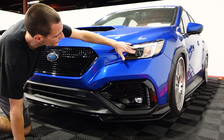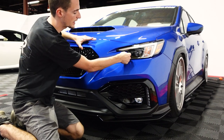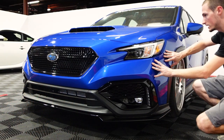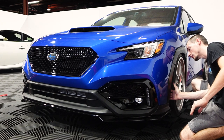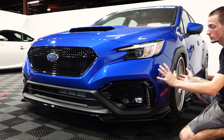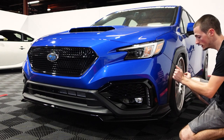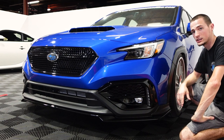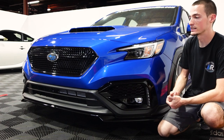When you come over to reinstall the side pieces, you're just going to come along the side and slowly push in. You'll hear that audible click underneath the headlight, then work your way around to the side. If it isn't clipping in, it could be stuck behind the fender guard. If it doesn't want to go back, you may have to pull back on the bumper and move it around the fender guard, then push it back in. But those are really the only issues you should have with reinstall.